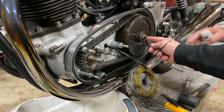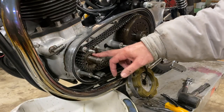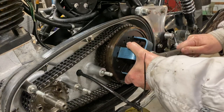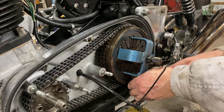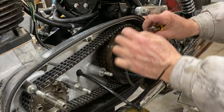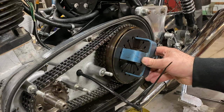Just undo that nut. This is your adjusting screw obviously. Then I've got the tool that compresses this diaphragm plate, pushes it in, and then you remove this spring because we've got to get to the nut that holds this on. Then we have the task that can be quite a challenge — is pulling this off. Just until it becomes loose and it'll actually start to spin. Now we've taken all the pressure off. Just put a little flat-bladed screwdriver in there, pull one little bit out, and then essentially uncoil it — kind of lift it as you take it off as well because it's in a slot, it's in a groove. Pull down as you do it. It's wound in there quite a bit. The secret is to leave this tool on it — not to try and disassemble that.